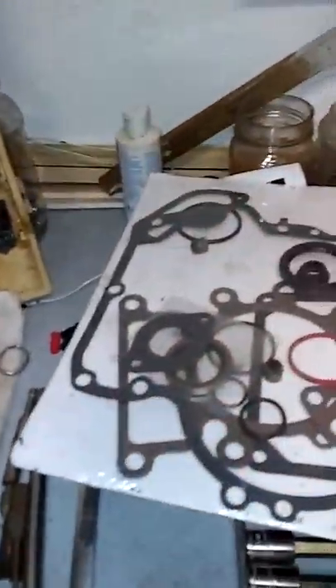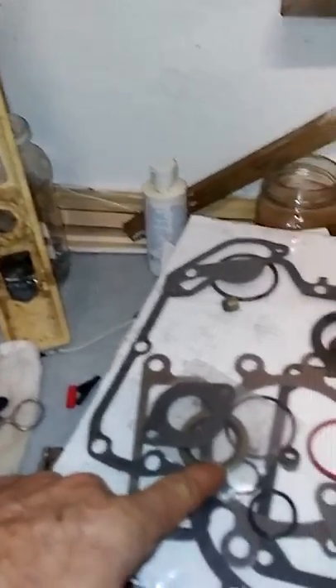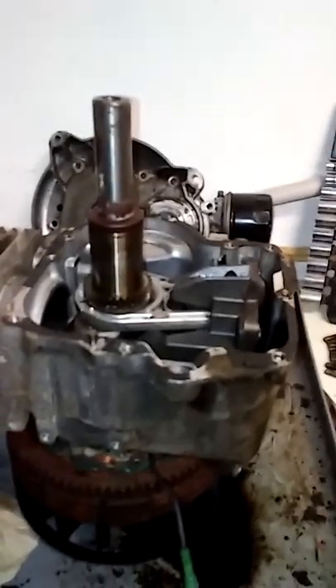Motor's in real good shape, everything's tight on it. We're going to put it back together and put the little valve caps back on the valves, put new gaskets on it, new seal in it — all the gaskets on. I'll put this one on right here, and then when I pop the flywheel off I'll put this one on. We've got carb gaskets. The head gasket I don't need to fool with because I'm not pulling the head — there's nothing wrong with it.